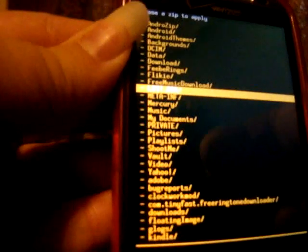We are done with the backup. Now we need to install the zip folder that we put on our SD card. The volume button moves through options. Select 'install zip from SD card' with the power button, then choose the zip from the SD card. Scroll through and find it — BAMF Remix 1.4 zip. Press the power button to choose it, then go to yes to install it.